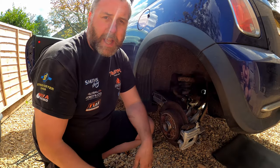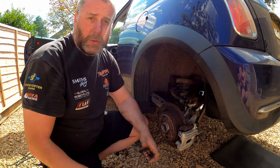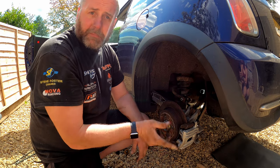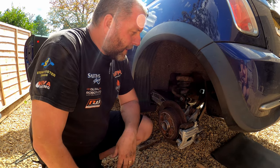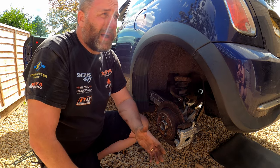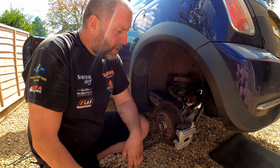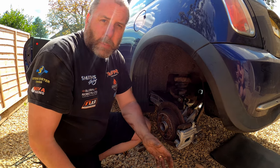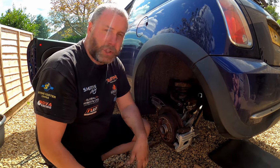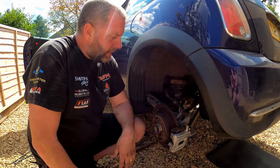Okay, so I've checked this side and it's exactly the same as the other side. It works perfectly. Five clicks and it's absolutely solid. Two clicks and it's just starting to bite, but when it's off, it's absolutely free spinning. Absolutely 100% happy with that, and it's a pretty straightforward job. The actual cables themselves cost, I think it was around about £24-25. Well, I'll leave a link to those in the description so you can go check them out. Not a particularly difficult job, just a little bit messy because you have to get under the car and you're working around the exhaust, which likes to drop flakes off in your face, which is never pleasant.